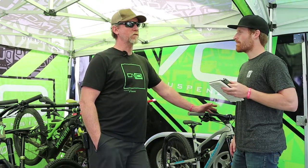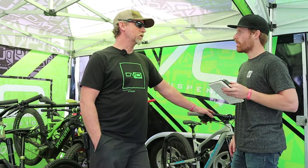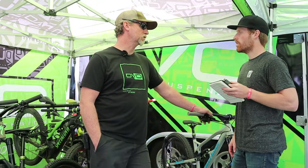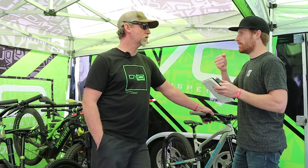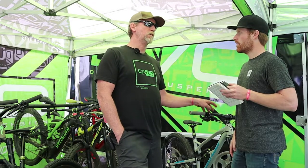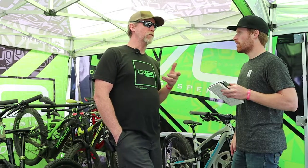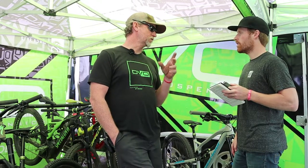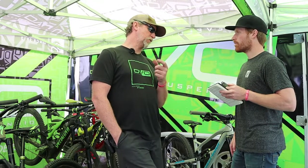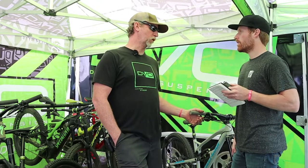But we've now addressed that. We are part of the chassis now, so we're increasing overlap and putting a little extra bushing in the shock, because there's a lot of side load going on. It's adding to the structure of the bike, whereas with an eyelet shock, it's more isolated from the bike and we don't have to worry about side loads. A damper is designed to work in a direct straight line, and when it gets pressure from the side, you can get quicker wear.